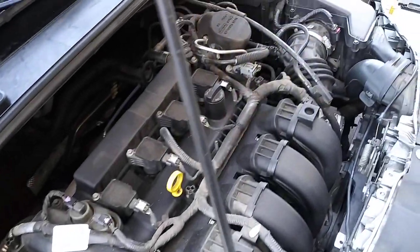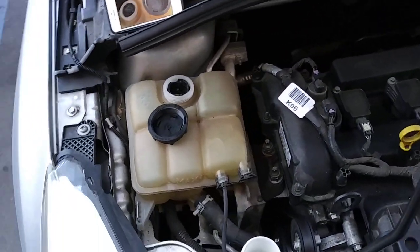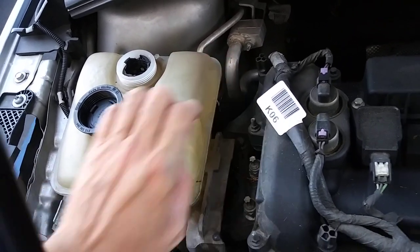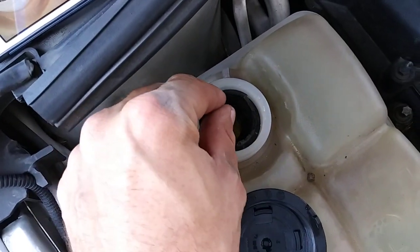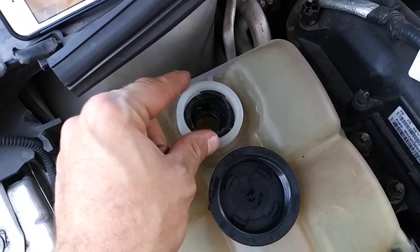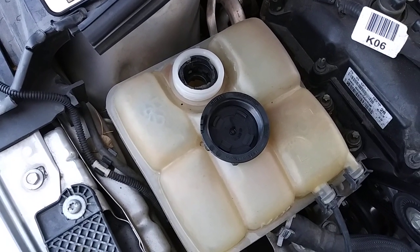This is just another headache in the saga of my life, but the coolant reservoir is pretty old anyway. I've tried to film this once or twice already to show you guys there's a crack going alongside down here — I can actually feel it with my finger, but I cannot show it to you on camera. I'd have to pull out the whole tank. If I start shoving screwdrivers in there trying to wedge and pull it out, I'll probably end up damaging it — it's all plastic and it won't create a proper seal for the new radiator cap.